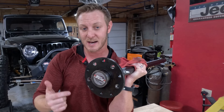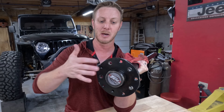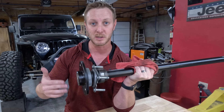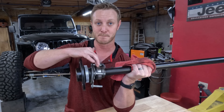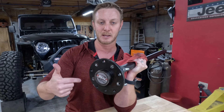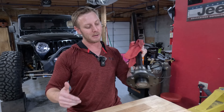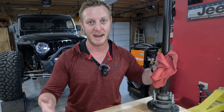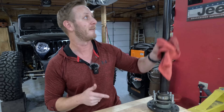On this side, your wheel, your rotor, and your entire brake assembly go on here. A semi-float axle is pulling double duty on the back of a vehicle — it holds the weight of the vehicle on this bearing, which is on this shaft, and it also handles acceleration and deceleration through the end of this flange. This is a problem when you start off-roading and adding larger tires, which is technically a larger lever to bend the end of this shaft.